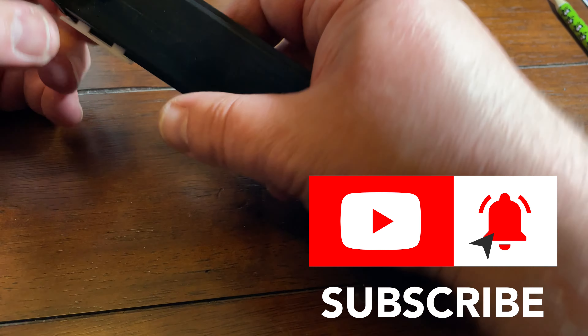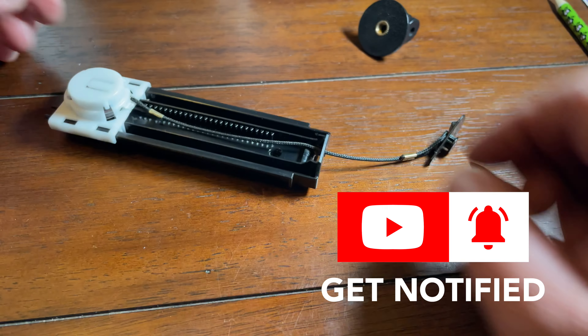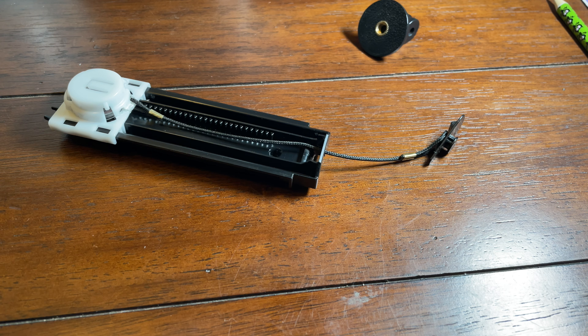When you put the parts back together, you have to hold the gearbox in place within the sled. Then insert the spring into the sled as I show here. The sled inserts into the rails only from this side — make sure you don't break off those little tabs. Now it is already assembled.